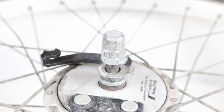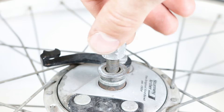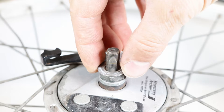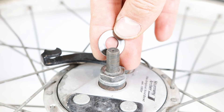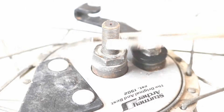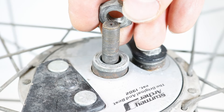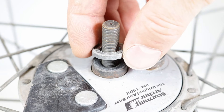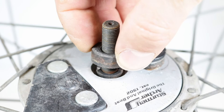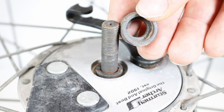Place the wheel so that the drum brake is facing upwards. Remove the wheel nut, lock nut, and the washer. Using a 17mm spanner, undo and remove the lock nut. Remove the keyed lock washers, noting how they are positioned. Remove the wheel nut.